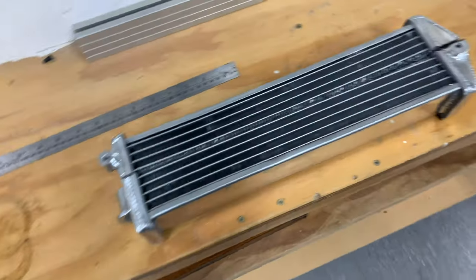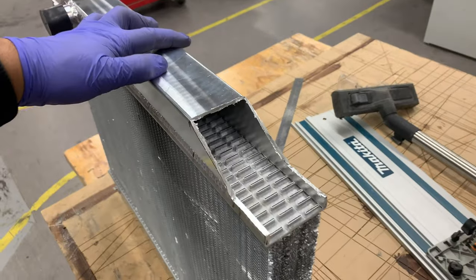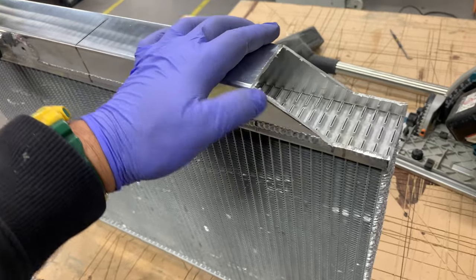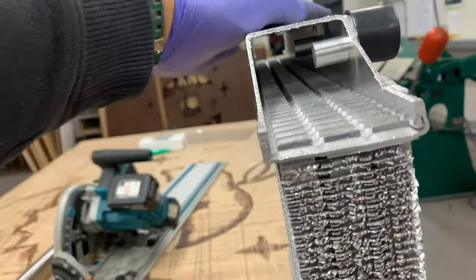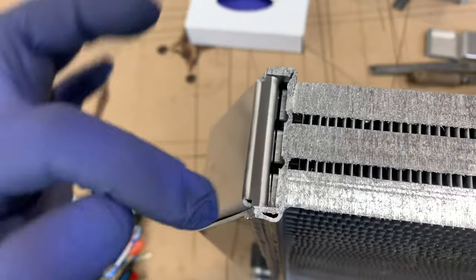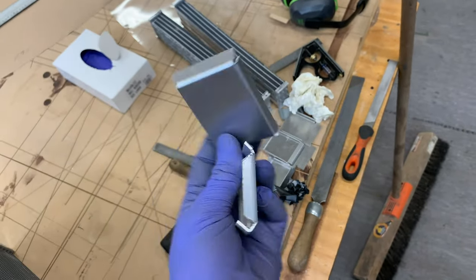That's what we've removed and we'll just chop off these parts here. I'm going to file all these and get them nice - when you use the grinder you get impurities so you just file them away, clean them up really nice, and give it a good blow out to make sure there's no stuff in there. Got the first one done, we'll put some stuff in there, fill it up, and weld across really gently. These are the bits I just made up - took a couple of goes to get it absolutely perfect but it's ready to go.